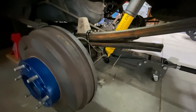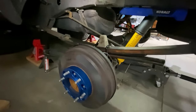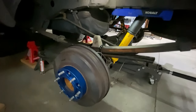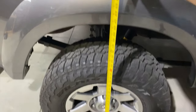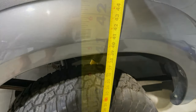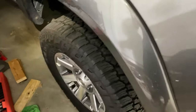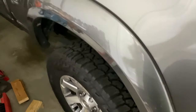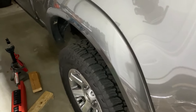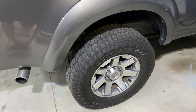New leaf is in, everything's torqued back to spec. Now it's time to lift the back end up again, mount the wheels, torque them, and then let everything down and take a final measurement. We just dropped the truck down — we are at 39 and a quarter to 39 and three-eighths inches. Mission accomplished! Awesome little kit, pretty cost-effective way to give your truck a lift. Now we'll clean up, give it a test spin, drive it about 10 to 15 miles, then double-check all the u-bolts and rear suspension for torque.